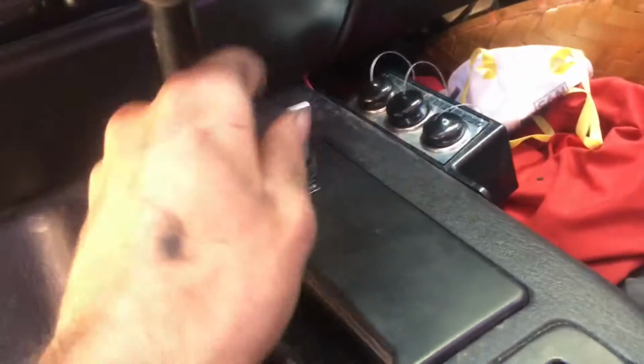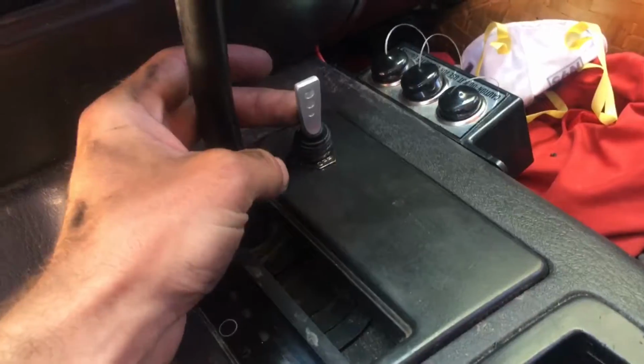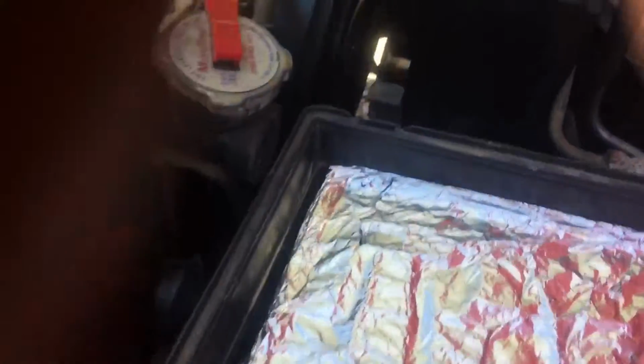And then for the switch, and I'll show you the fan working in a second. Put right here. Alright. Check that out. Sorry, I have my headphones in. See the fan working. You don't have to worry if you accidentally hook it up backwards, because it'll just run backwards. It's a DC motor. I'm going to put a fuse in here just to protect it. So let's see it running.